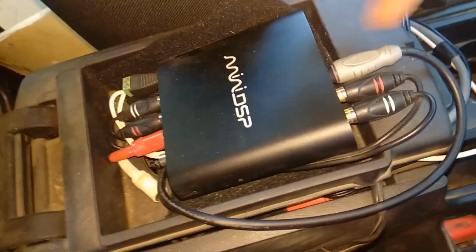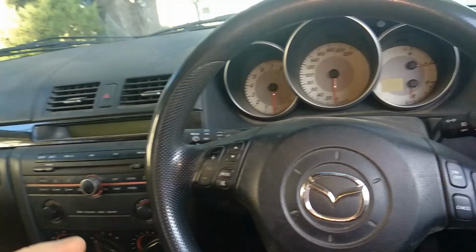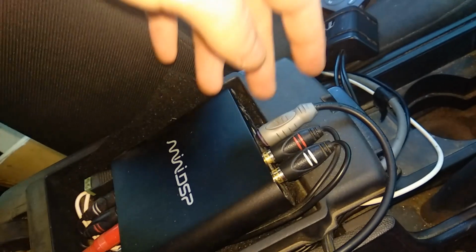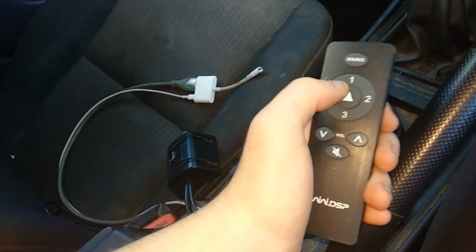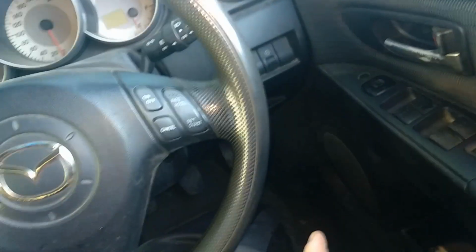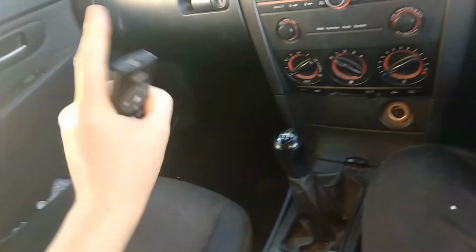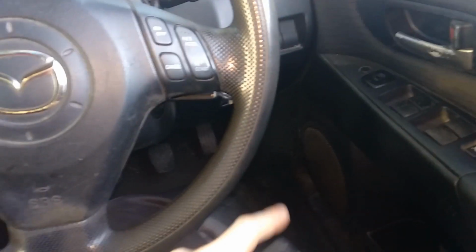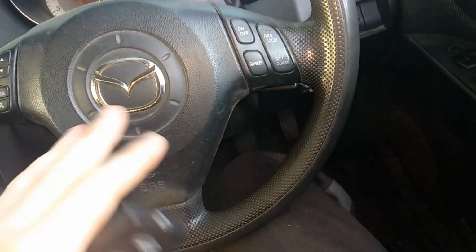Like this thing here, it's amazing. Time alignment too is incredible. I've got it time aligned. I've got two presets on it. The first one, preset 1, is time aligned for the driver and EQ'd and leveled. So this door right here is a bit quieter, and that one there is say 0, and this one like -2 dB, as it's a bit closer, just to even it out.